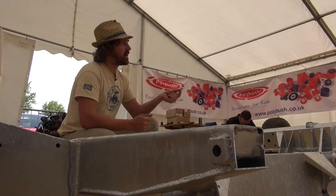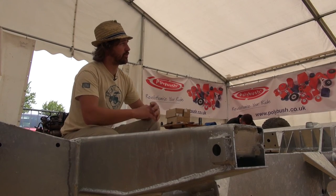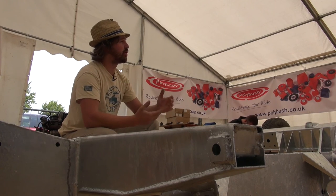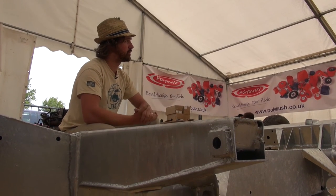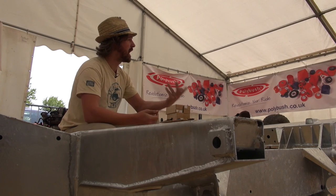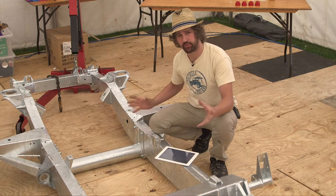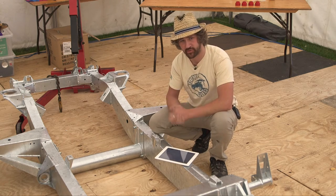What I would say is if you have a chassis that wasn't originally galvanised, then routine maintenance using products such as wax oil, Tetra, and there are many others around, that will keep the chassis going for a bit longer. And it has the added bonus that it still looks original and is as it left the factory.